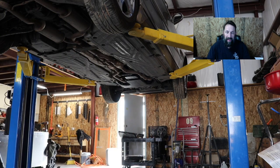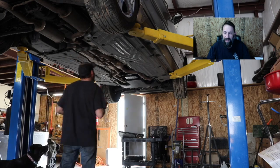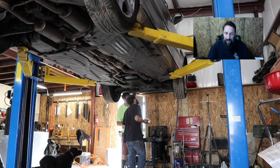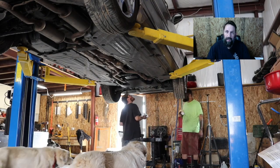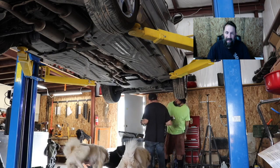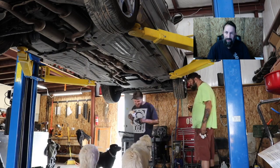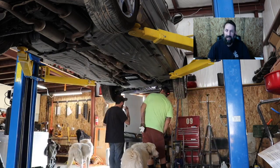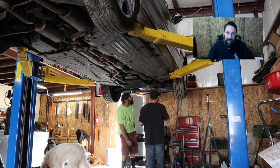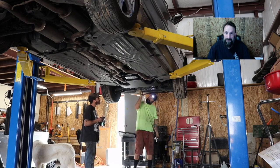We finished with adding some bolts to the exhaust and topping off the coolant, which was low. While we were under the car, we did see some puddling oil that was hanging in the plastics. Not one drop of oil has dripped off the car yet and onto the ground. So we're not sure if this is an active leak or if it's an old leak or something else.